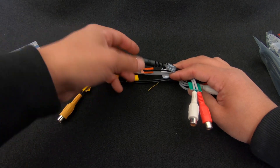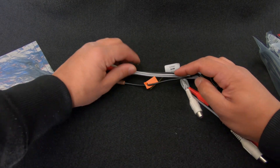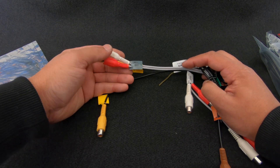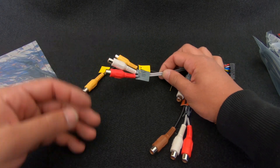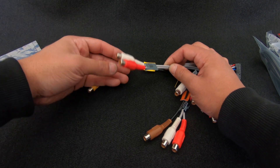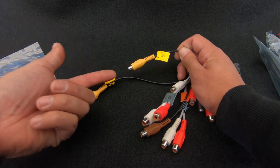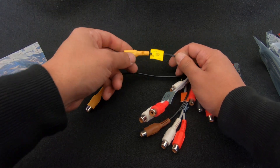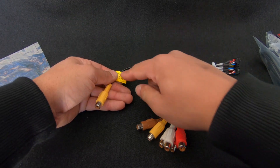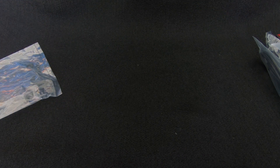You can plug in an AUX cable, though no one really uses it anymore and they don't even supply the cable because it's becoming obsolete. Reverse camera input — perfect. Audio input: if you've got a genuine AUX point in the car and a harness to retain it, it will have the RCAs that connect there. Video input — if you have something with a video output you can watch it on screen, maybe for rear monitor screens. And rear monitor output — if you've got monitors with an input you can relay what's on screen to a monitor in the rear of the car.